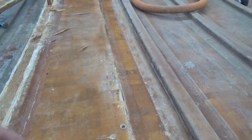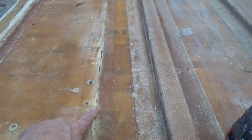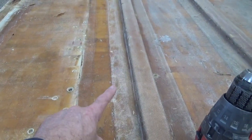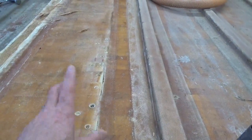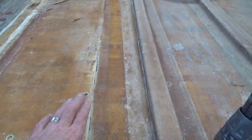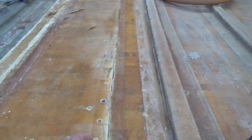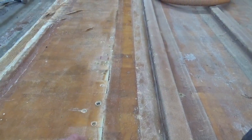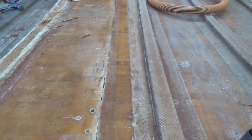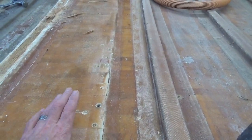While I was doing that, I noticed that this joint right here has got quite a bit of a rise in it. I'm not sure if it's where the short version meets the long version or where it was joined, but regardless this is what I have to deal with. I was going to sand it flat, apply putty to fill in all the little dips, make it flat again, and then apply a layer of chop or something, then put the gel coat on top of that.